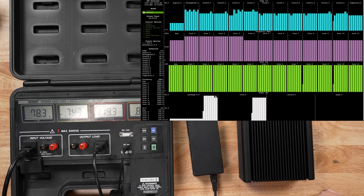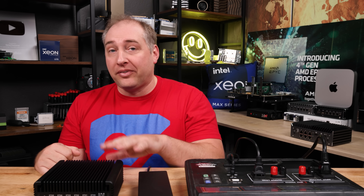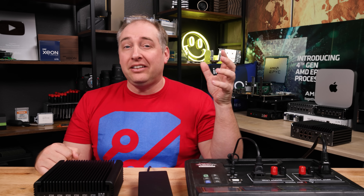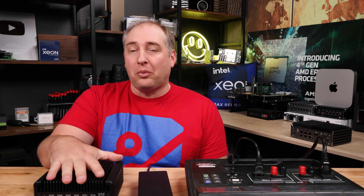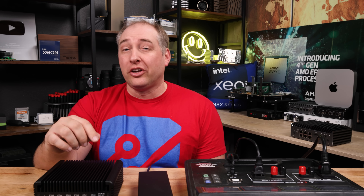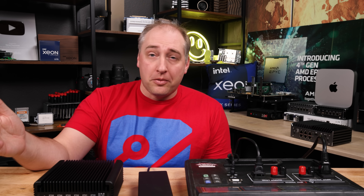Let's start running a workload on this. You're going to see power consumption right now is like 76 to 70-something watts. That's actually pretty decent power consumption. However, this system is configured to clock down pretty quickly, so you get that really quick spike up to the mid-seventies range, and then we're down to about 30 watts or so. The chassis is pretty hot — I can put my hand on it, but I wouldn't want to leave it there for a long time. If you did want to go and play with some of the higher performance levels, that's really where I would start looking at getting a unit with a fan — some of these systems come with it, some don't, so that would be something to ask the seller. There's also a big variance in power supply quality depending on which vendor you purchase from.